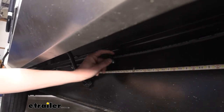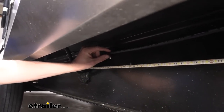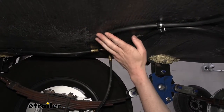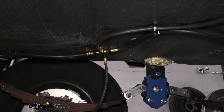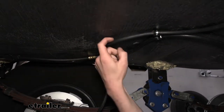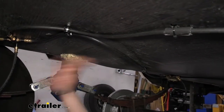It's important that you use rubber-covered clamps so they don't dig into the flexible line. Further back, that's our main line. You get plenty of line in the kit with plenty of excess length. For example, this line going across the axle - I had to make a couple of S-patterns to take up some slack, which means it'll work on different widths of trailers. The cross lines are plenty long, and you get a line with plenty of length to go from axle to axle as well. If the spacing is slightly different in your trailer, there's plenty of excess.